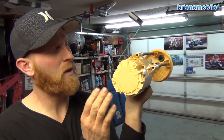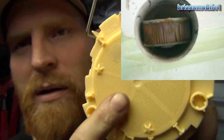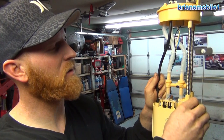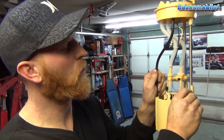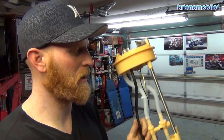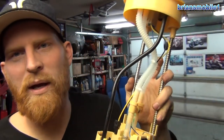As for the crud at the bottom — remember the crud we were talking about? There's a really fine mesh strainer with a sock after that — not a cotton sock, more of a plastic type sock. Basically, if you're at half tank or full tank, you've got fresh gas coming in. Once you get down past halfway, you're sucking through just this sock at the bottom. If you have your tank more full, you're not sucking crud as much, and that keeps your fuel filter from getting plugged up.